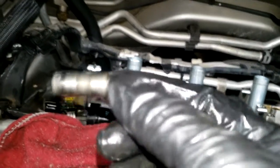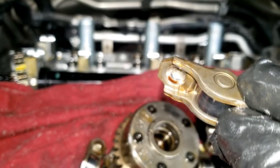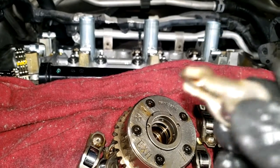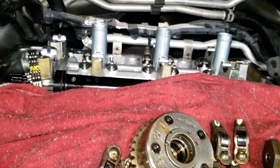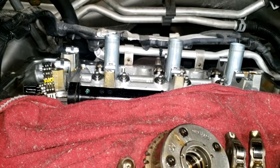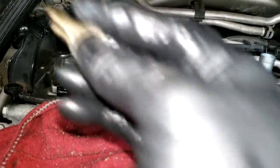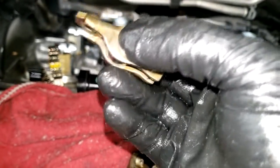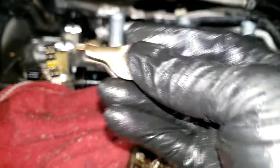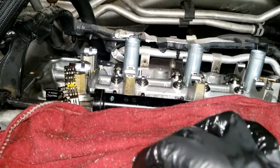In the beginning, guys, when we first had these ticking problems, everybody was replacing these. We never suspected the rocker arm would give us that type of problem. As time went on, it was revealed that the rocker arm was the problem. We were getting misfires and everything. We were getting beat up here at the dealership. Chrysler had to get involved on a couple of cars, had to buy them back and things like that. No one knew. Once it was finally discovered that the needle bearings inside this roller bearing were coming apart, that's when we found the problem and started making the necessary adjustments.